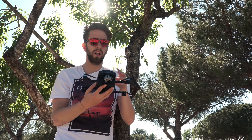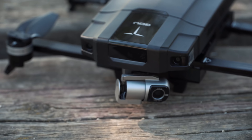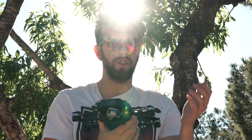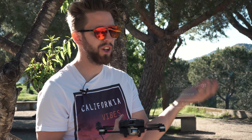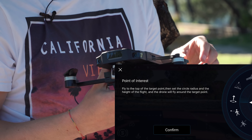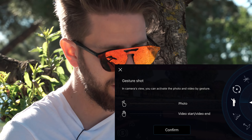Good things about this drone: the flying experience was not bad at all — I actually enjoyed it. It has vision sensors on the bottom and forward sensors for obstacle avoidance. We tested it on a tree and at three meters it slows down and stops, similar to what DJI does. Obstacle avoidance has to be manually activated as it's off by default. There's also an RTH button where you can set the return altitude. In the app you can choose between novice and classic/pro modes. In novice mode there are intelligent flight modes — dronie, circle, rocket — very similar to DJI's functions.